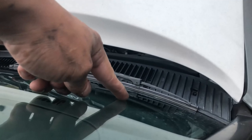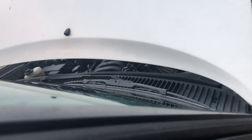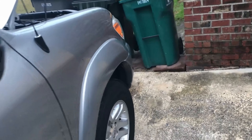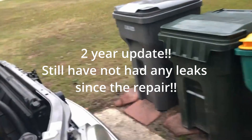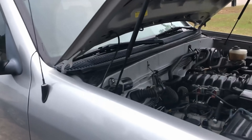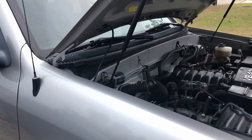Take out the bolts for the blower motor, remove the blower motor, then shoot water down through here. If you're getting water through there, that's the sign that those clips' gasket material or RTV is bad and creating the leak. When I shot water in, it dripped down and that confirmed the problem. For anyone having this issue with a 2006 - or I believe 2001 to 2006 - Toyota Tundra generation, this is a common issue, a poor design flaw. Here's how you fix it. Thanks for watching.